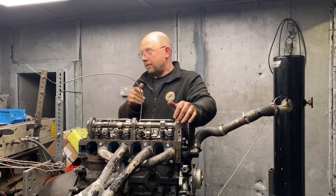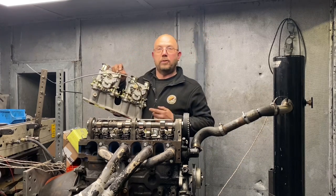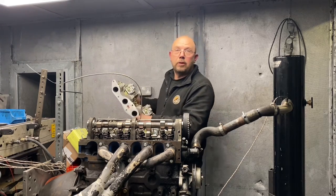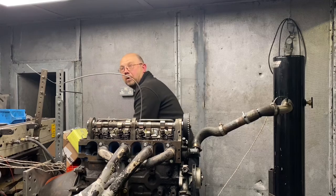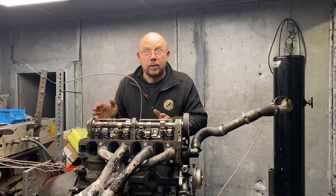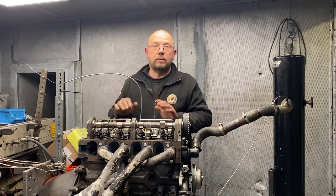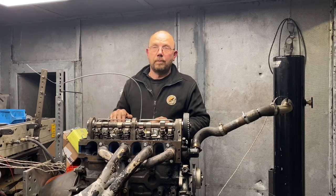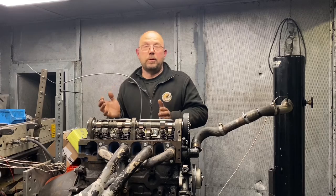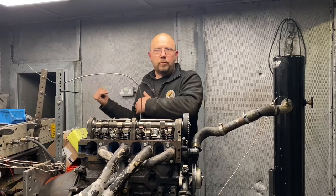The other thing we're going to do — currently the engine is fitted with a pair of 45mm side-draft carburetors. Ross has 40s but we're going to run it up on these 45s first because they're what I last ran, they're what's connected to the dyno, and they're already jetted pretty close to where this cam needs. We're going to bed the cam in on these and dyno on these. They're currently fitted with 34mm chokes. I will try a 36mm choke — I don't think it will make any more power on the 36s but we're going to try them, and then we'll put it on the 40s.